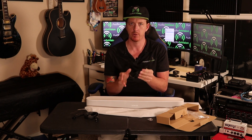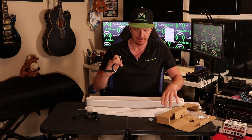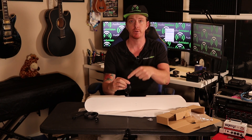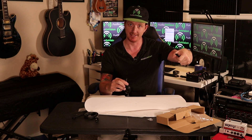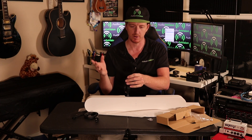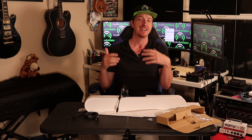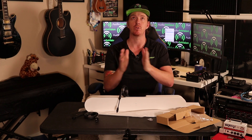You've got two ways of connecting to your TV: HDMI into the ARC port, then go into your TV settings and enable audio return — though ARC can be a little finicky, sometimes it works, sometimes it doesn't. Or use this optical cable, which plugs into the optical audio out on your TV. Most TVs being manufactured now still have optical audio out, which I appreciate.